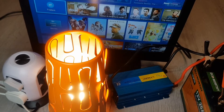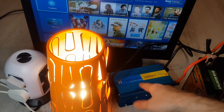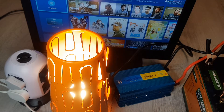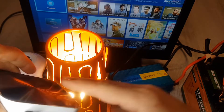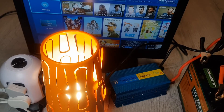I'm not going to plug in tons of stuff like hairdryers to max this out — hairdryers are about 1500 to 2000 watts and this is 600 watts, so they're not going to work. With your appliances, just check the maximum wattage. For example, this USB charger has a maximum of 50 watts, so that takes away from the 600, and the other appliances add up too. Stay within the 600 watts — I wouldn't push right up to it — and you should be fine.